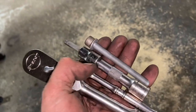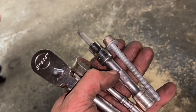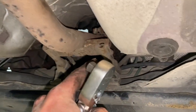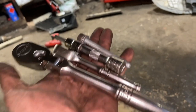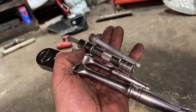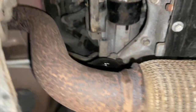So I've got two of the starter motor bolts out, with these Allen keys here. They're a bit awkward too. The bottom one was real easy, but the top one, the best way I found was reaching in from the right hand side with this, then coming up with my hand over the exhaust and guiding it into place to fit the bolt. I cracked it off with a bigger ratchet with a flexi head, and then got in there with a little ratchet. This little bracket really gets in the way. But now I've got two of the bolts out.